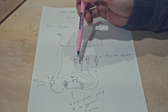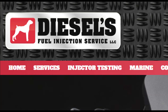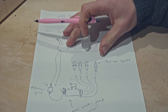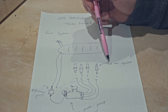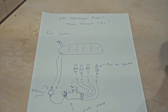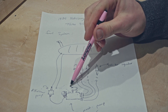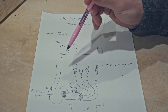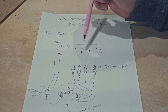This pump has four separate leads for four injectors — it's a four-cylinder motor, pretty straightforward. These injectors are all rebuilt by Diesel's Fuel Injection over in New Hampshire. They are 155 bar injectors. Originally I think they're more like 120 bar because it was a naturally aspirated motor, but you want the higher pressure, which means shimming the springs, because it makes for a better dispersion pattern and works better with the turbo setup. Any excess fuel in the system just goes right back to the tank via the return lines — pretty straightforward.